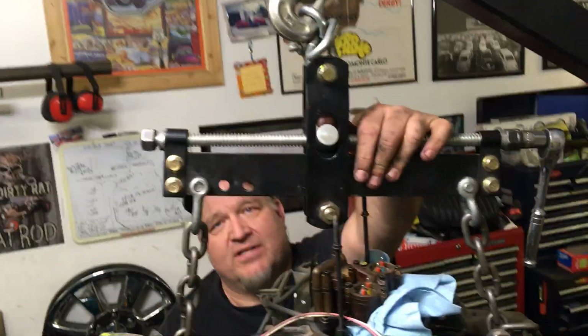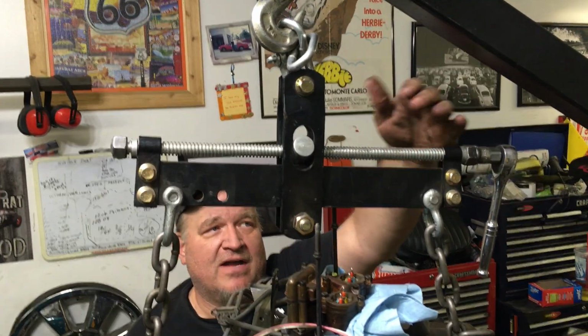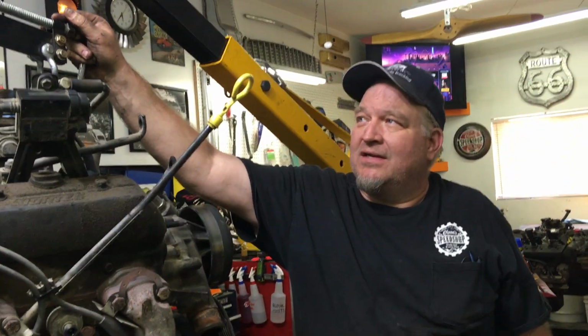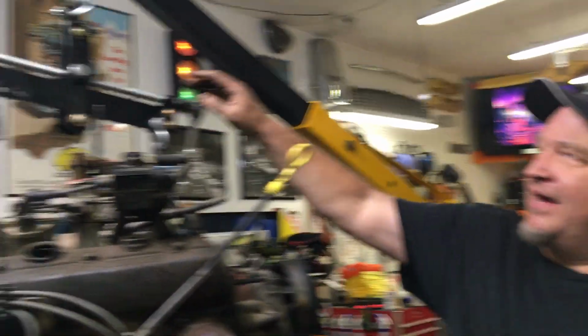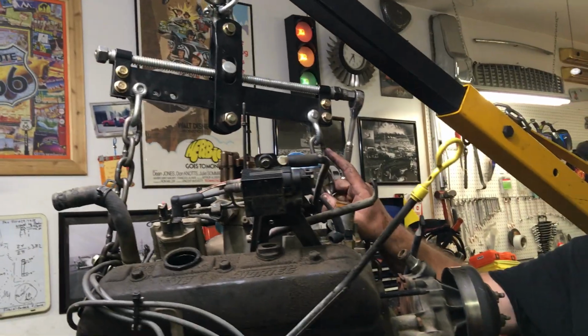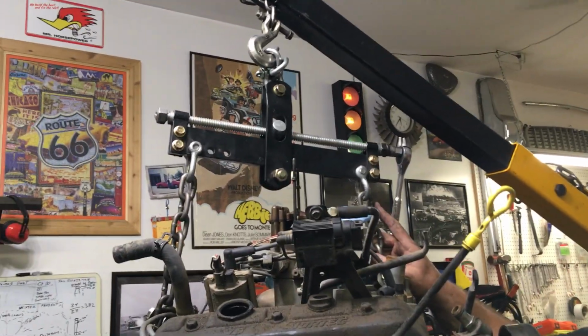One of these equalizers here really helps out. I've used that. I actually bought this. So if you get a Harbor Freight, this is a Harbor Freight load leveler. Read the reviews on the Harbor Freight load leveler. They're bad. These things explode. Bolts break, they'll explode. I've heavily modified this one. I just got the initial setup. I have redone all the chains. The chains are my own. If you look at the Harbor Freight ones, they're usually not welded here. Kind of scary. But I've replaced all the chains.